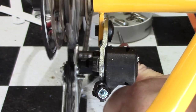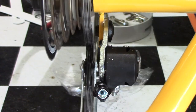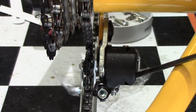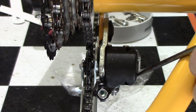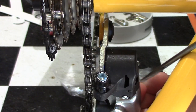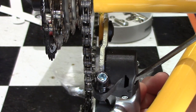Being very careful, I use my thumb to push the derailleur over sideways. You can see here that it's not going all the way up to the top gear — gear position one. So I adjust the other screw on the derailleur to give it more movement.